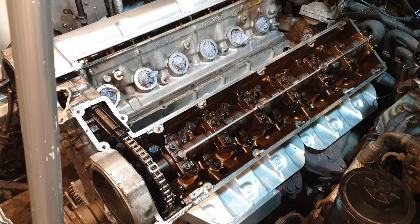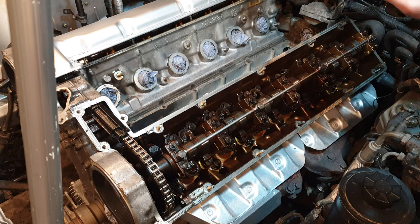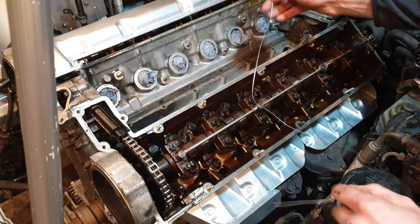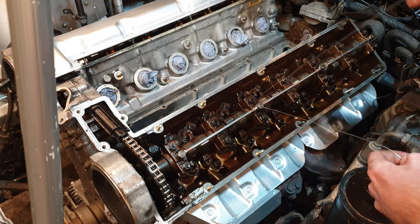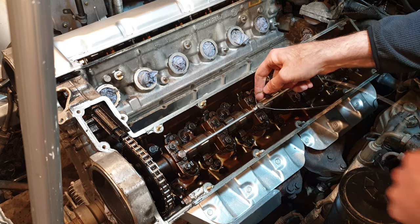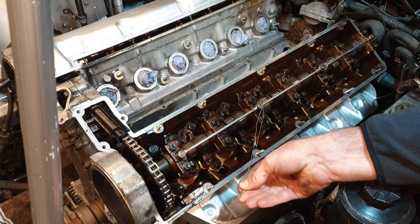Okay, so fast forward a few minutes, I have this one done. I wanted to familiarize myself with the process before I showed you guys how I do it. First thing I do is get the safety wire. I've got a length cut off here, and I pass it around this right hand bolt, and I make the top section of the wire ever so slightly longer, so that they're equidistant after I wrap the long side around. As you can see now, they're both roughly the same length.